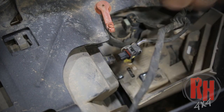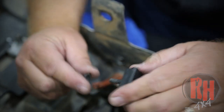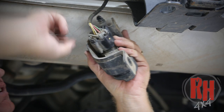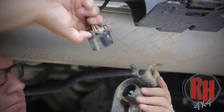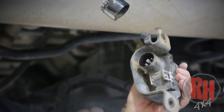Next, you will take out the other sensors and then take a 10-millimeter socket to remove the light. This has plastic screws that hold the light in place. There are cap nuts that go on here — you want to save those as we're going to reuse them. To remove the electrical, push in on this plug piece right here and pull it off. Now you can remove this from the housing by pinching the metal clips on both sides.